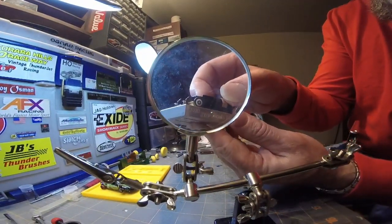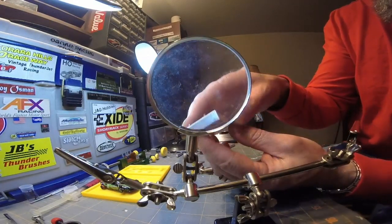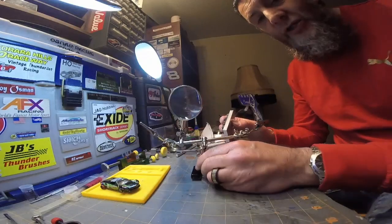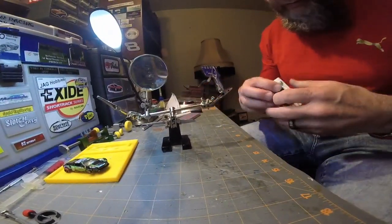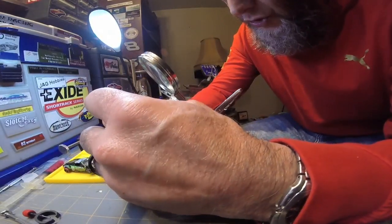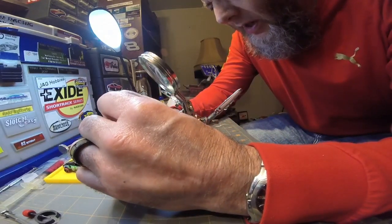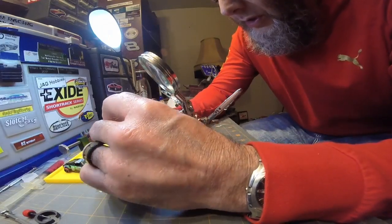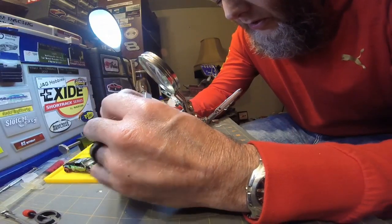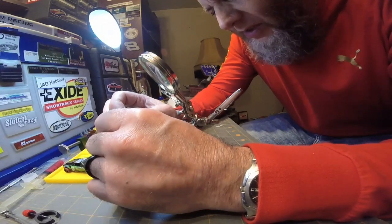I use it for looking at my shoes all the way down the tech block to make sure that they're making contact all the way down the shoe. It's a lot easier to see if you're missing contact when you get a really, really close look at the shoes. And lots of times with these wizards, you get it pretty close right off the bat. Now, both of these look like they're riding on the heel. So we're going to have to adjust that just slightly.